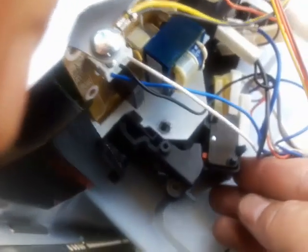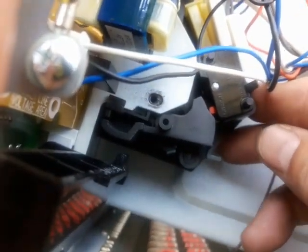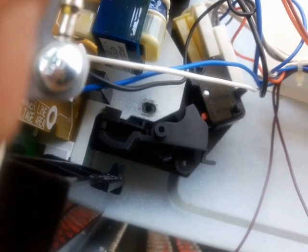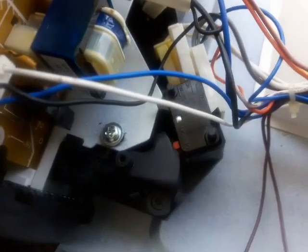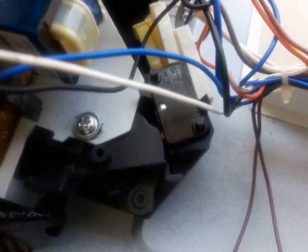Okay, so now I slid that tab on top. It matches this one, because when I took the microwave apart, these things are held in place by tabs, and that one looks like it was out of place. So now let me put the screw back. I just put that screw back with the tab above that metal frame. Now let's test it out. See how that thing pushed the switch? Let me open the door. Oh man, yeah, I think that's the problem right there.